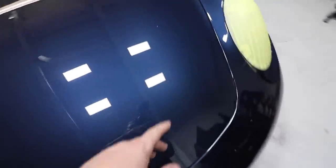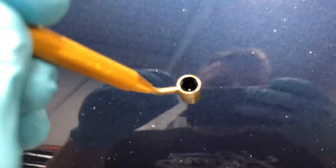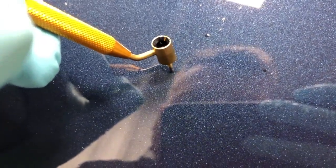There are a couple rock chips here, a couple up top, and a bunch down here. I don't have my big camera, but I wanted to show you this regarding the touch-up paint. What I'm doing is using this pen — I'm going around tediously one by one and just dabbing on paint into all the stone chips. Let me flip the camera around and show you. This thing is amazing — I'll link it below. You just put some of your touch-up paint right in there, see all these chips, and just dab away. It makes doing rock chips so much easier, especially when there are a ton of them.